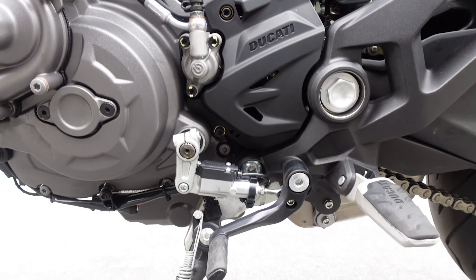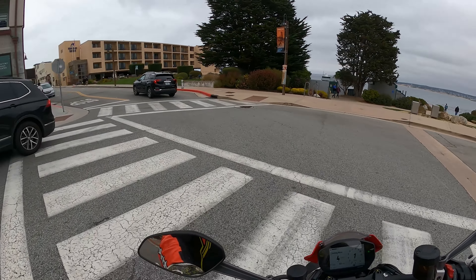Changing the riding mode on the fly is actually very, very easy. You push the mode button, that takes you into your settings. Push the arrow key up to touring, push enter, close the throttle, and now we've got 111 horsepower with some tame throttle response. In touring mode you also have a little bit less ABS, a little bit less traction control, and a little bit less wheelie control — so you get a little bit more controllability.